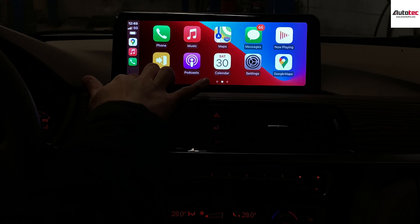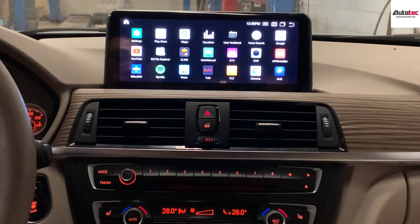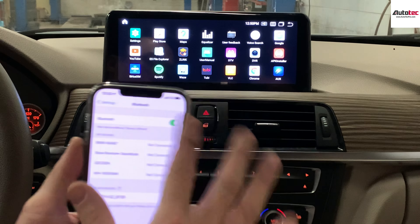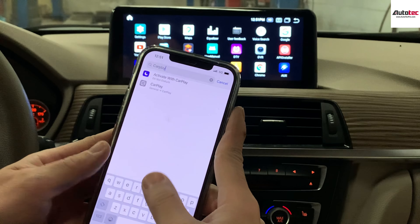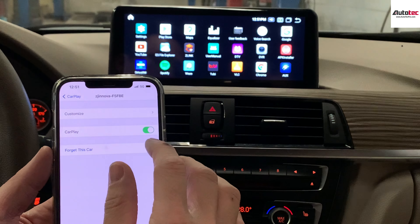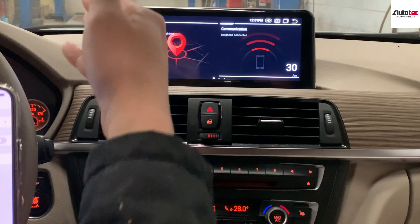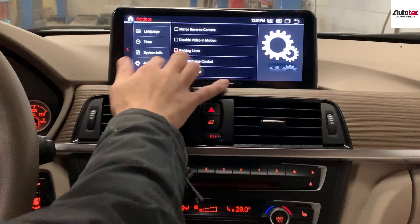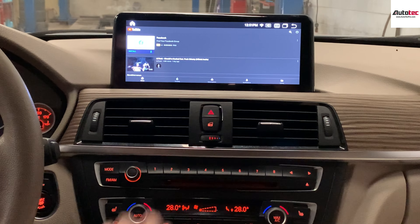Since Apple CarPlay won't allow you to watch YouTube or movies, here's how to switch back to Wi-Fi. Go to your cell phone, search for CarPlay in settings, go to the CarPlay device listed on your phone and turn off CarPlay. Once CarPlay is off, turn on the hotspot on your phone and connect to the system — then you can enjoy YouTube and Netflix.